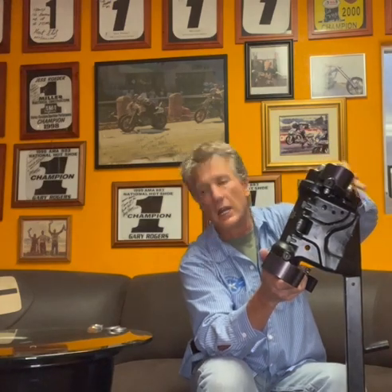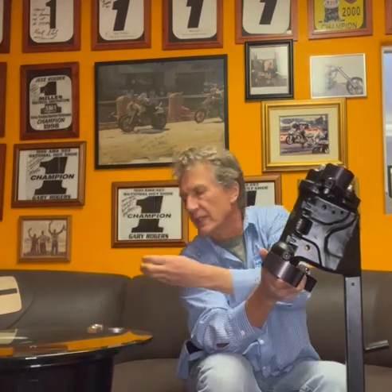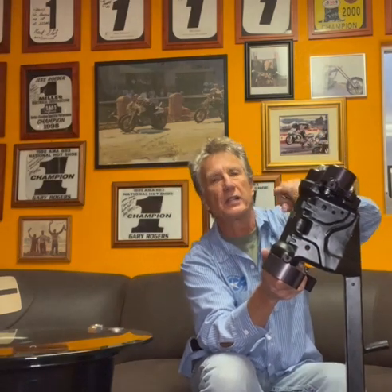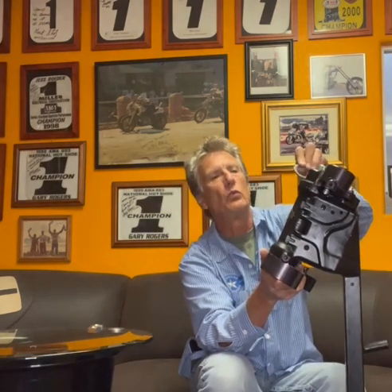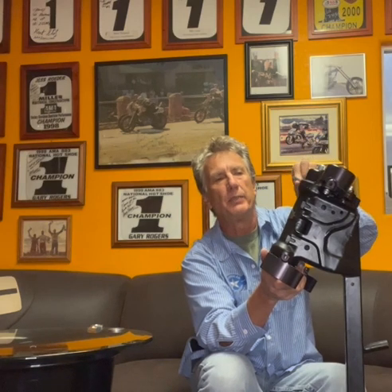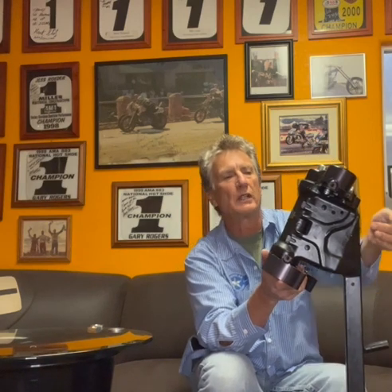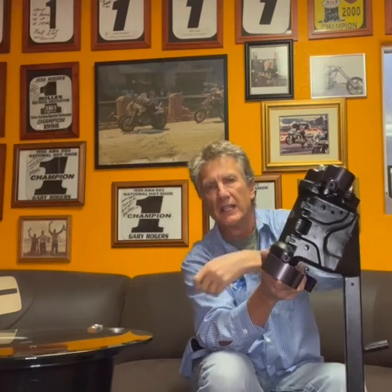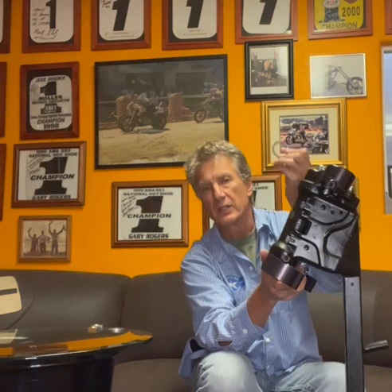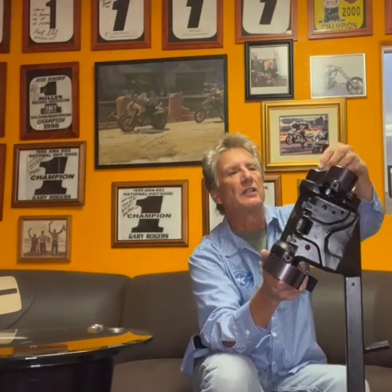You'll put on your top tree. Now sometimes on some bikes you'll want to put a washer on top of the bearing stack to give you a little more clearance. There's a lot of variation in these frames, so we include a washer — sometimes that washer fits there.